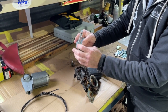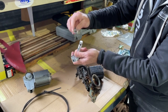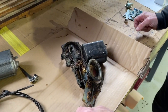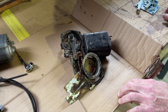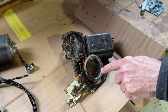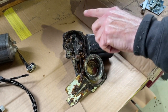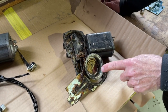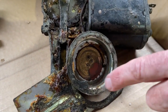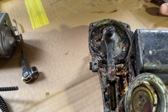all day long. So this is the gearbox. This is what we were playing with in our wipers. This is how they engage. Very straightforward. But here's where it gets very wonky and very typical for the era. This probe right here, this finger, is riding on this gold disc, round and around and around. You'll notice there's a red section here, and you can see the track in the gold disc where it's been going around and around on that finger. This one's bent, and that's probably partly why it was taken apart.